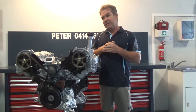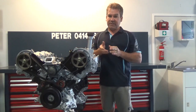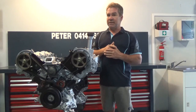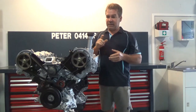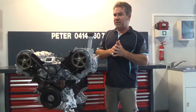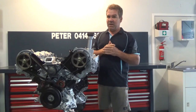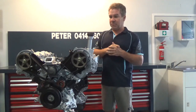The other main reason is crankshaft tunnel issues. Traditionally these things, if you're an owner of one, you'll notice the oil pressure gauge probably reads quite low — that's a reasonably common trait with these. We have changed the clearance on the mains a little bit to try and bring that oil pressure gauge up. They generally run about 3 thou; we try and drop it back to 2.